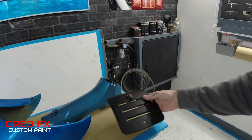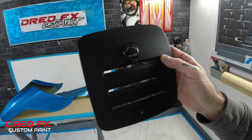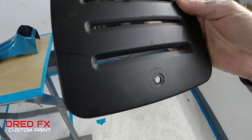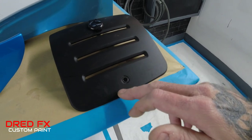We've got the door which the customer — and I think this is really cool — he's put a 12 volt, 120 watt outlet on there and done a nice job of that. He said to me just spray it in black paint, and when he gave it to me I thought yeah that's fine, we can sort that out. But when you look up close, you can see all the crazing. That's paint reaction. So this needs sanding all back. We've got a little bit of filler work to do around the edge here, and this will need plastic priming and sorting out.